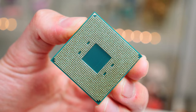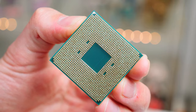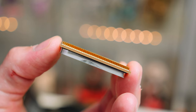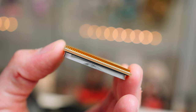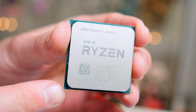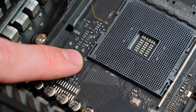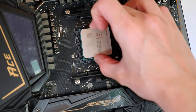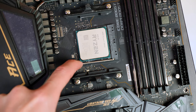The first step is to prepare the motherboard by installing the CPU. On the rear of the CPU are pins — do not bend or damage these at all or you will ruin the processor. You'll also see a gold dot in the corner; match this up with the marking on the motherboard. Open the slot by releasing the latch, gently set the CPU in place — no force needed — then close the latch.